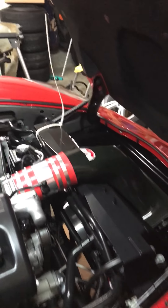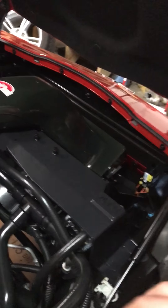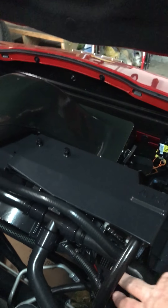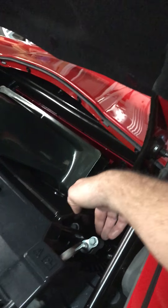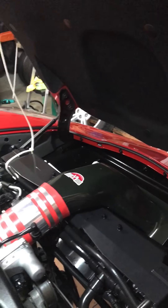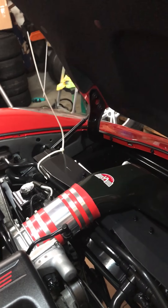As you can see, I have a tie strap over there — I'm ready to take that off. But the first thing you want to do is support the radiator. I ran a tie strap through right down in here and just get it around it, run up around this piece right up here, just run it back through this side. I ran it up underneath this right here, back around. I use a large tie strap — the kind guys generally use for HVAC.